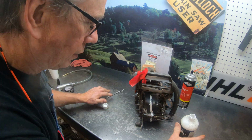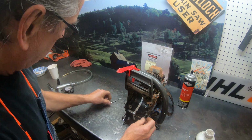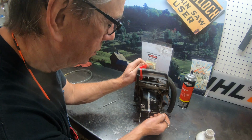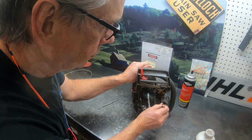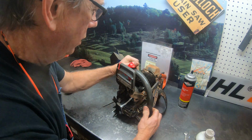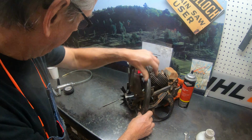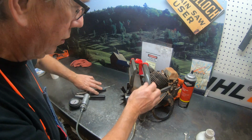What I'm going to do now is take off my spreader, back it off a little bit, close that up. See how it just closes that gap right up? Just relieve the pressure on it. I've got one of my custom caps on here for pressure vacuum testing, and I'm going to apply some vacuum to this, and that'll just pull that stuff right in there, making it really nice to seal. Put it in the vacuum mode.